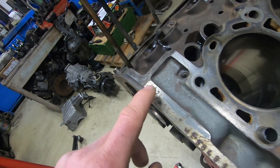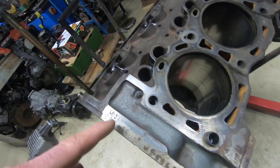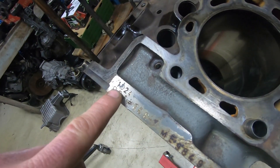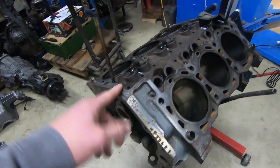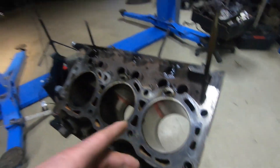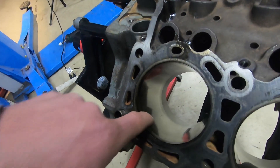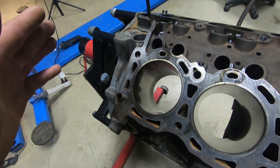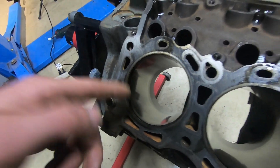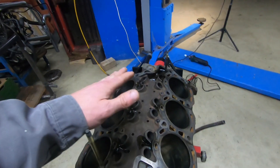I've checked the markings here — it says 1D24. As I understand it, that means year '91, D meaning the fourth month (A, B, C, D), so the 24th of April 1991 — that's the date of making of this cast block. First things first, I visually checked all the bores and they actually turned out just fine. We have a little scratch here, but that's all there is to it as far as the damage goes. This scratch doesn't really appear very deep and I think it will go away with honing the cylinders.